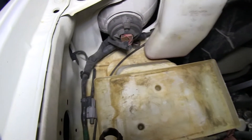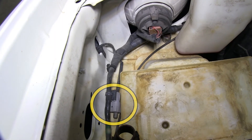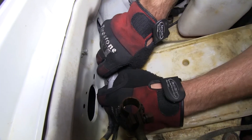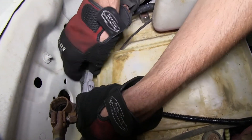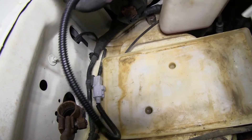With the battery out of the way, we can see the gray plug, or terminal, here up against the fender well. We'll need to remove the cap. Pressing on the locking tab, we'll remove the cap from the terminal connector. Then we can take our new tow-ready connector and plug in-line with the manufacturer's wiring. We'll route it out of the way, and now we're ready to go ahead and start reinstalling the battery.